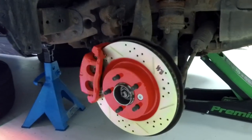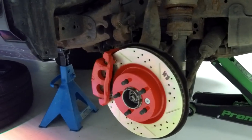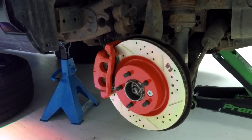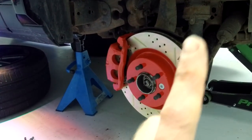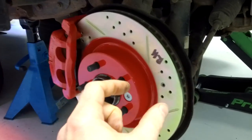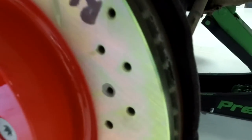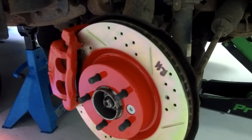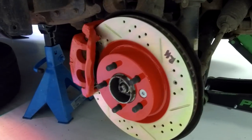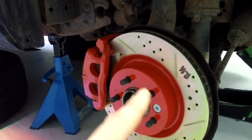We have fitted the larger brake discs. They're not as big as the Discovery 4 - the Discovery 4 had 36 centimetre diameter discs. We have done the Discovery 4 brake upgrade on the front and I'll put a link to it there, but that's really just upgrading the large brake discs to drilled and grooved types. So we're going to show you fitting the bigger diameter brake disc and the associated slider, plus these drilled and grooved brake discs which give you better cooling, keep your pads cleaner, and are better for off-road. This is great if you've got a caravan or you're towing diggers and trailers.